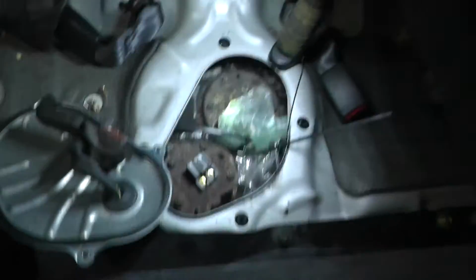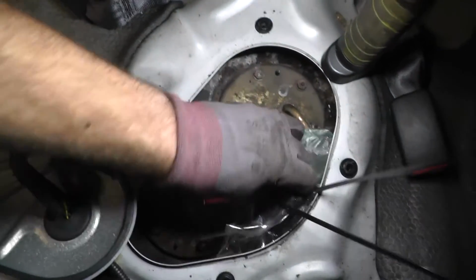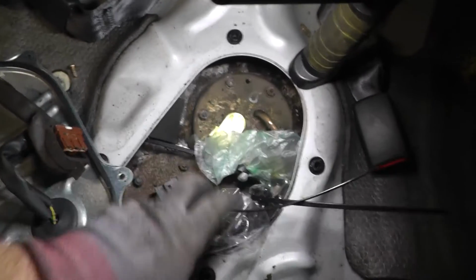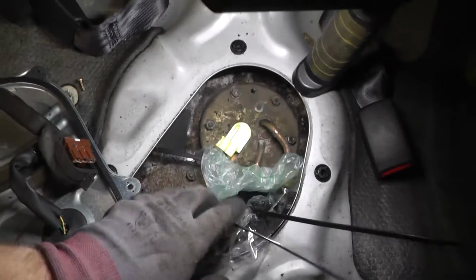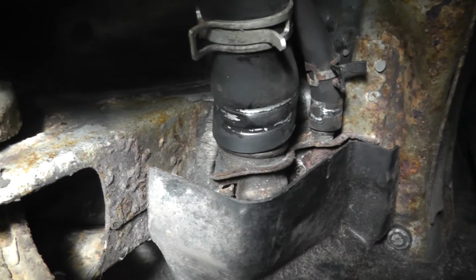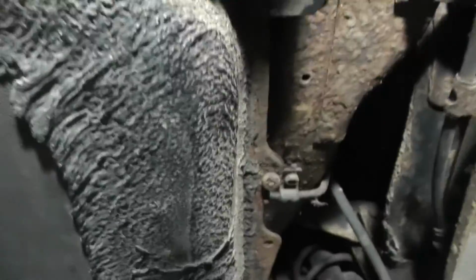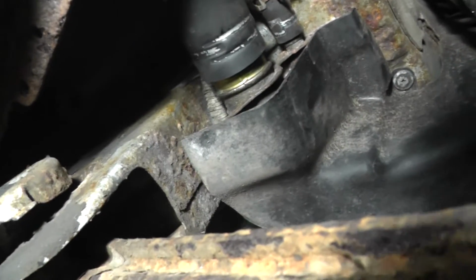It's a good time to also check that you're okay up here. So we've got our two connections there. If they were trapped or pulled down or something, you'd be a bit stuffed. So I'll take off all these zip ties and connect these up. They're just up in there now. And I can just place the little connectors on, just with these. Get this little breather as well. That just needs to go up in there. I've actually connected up the other strap because I needed to take the tension off these. So then I can just push them the whole way home and put those clips on.